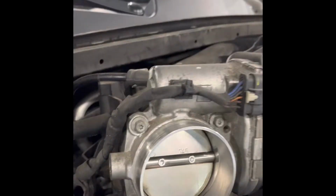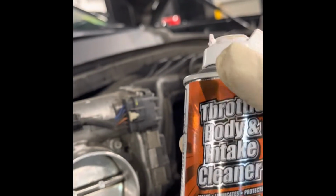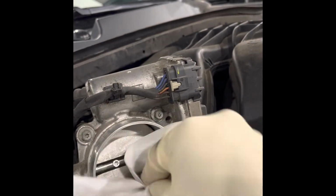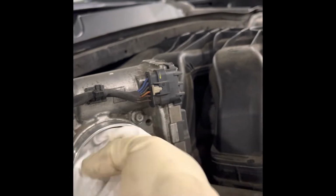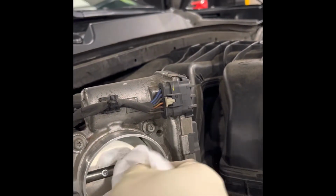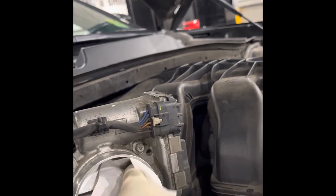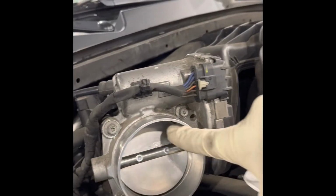Take advantage of this time to show you guys how to clean a throttle body. So spray this, you can use any brand, I use DG. And we're gonna wipe anywhere that you feel carbon when you see it. Very important, keeps the throttle very accurate. You know, these wires send signal to your computer and determine how much fuel to use. Especially now, that's gonna have more airflow. The more accurate, the better outcome, right? So, there it is. Nice, clean, and free throttle plate.